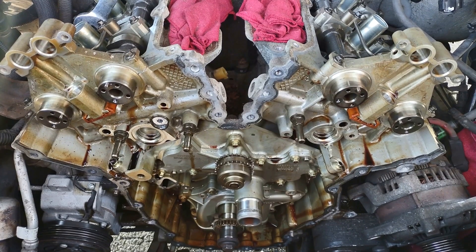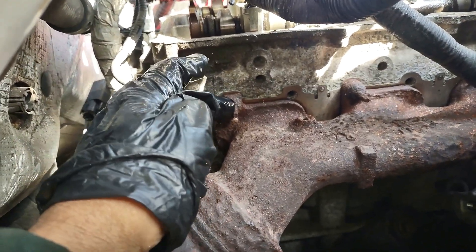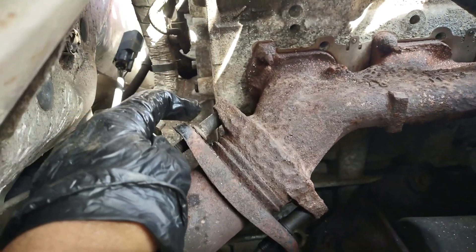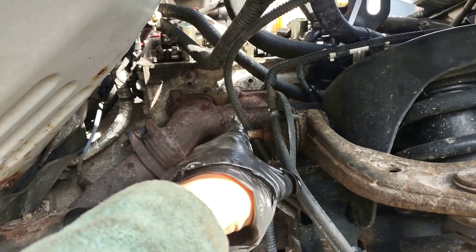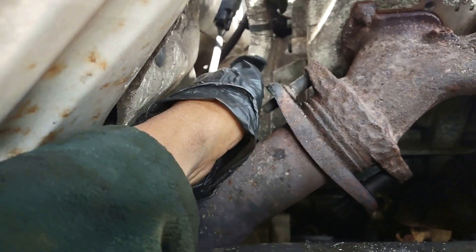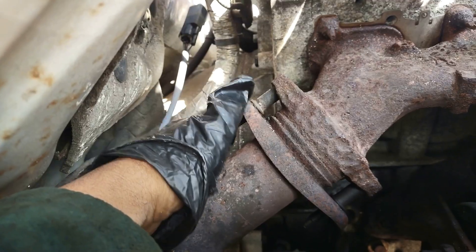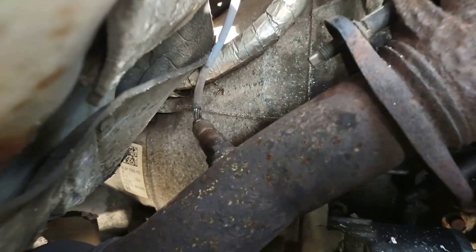Without any timing components, you can see the exhaust manifold. The bolt heads have been eaten by rust — no way to grab them with any socket. We're going to cut them and pull out the cylinder head with the exhaust manifold attached. We're not cutting on the other side because there's no space to weld back there. The O2 sensor is right there, and just below is the catalytic converter.